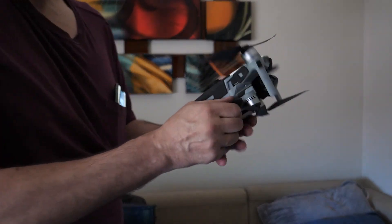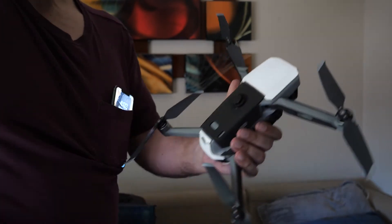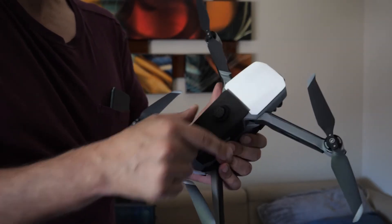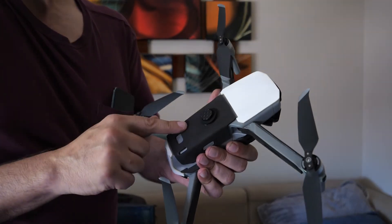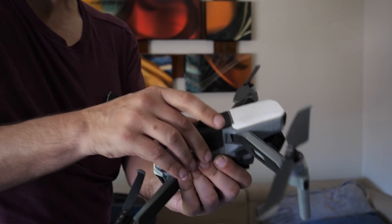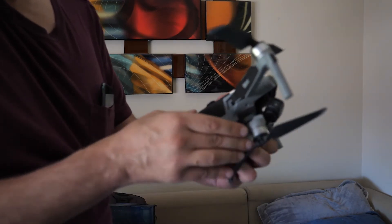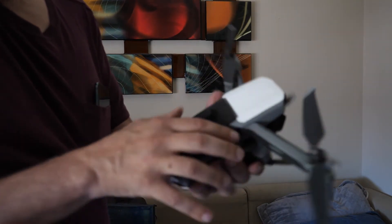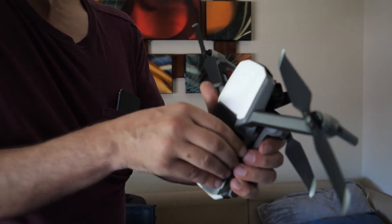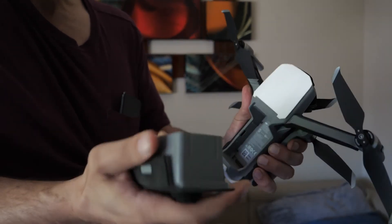The same exact thing applies to the Mavic Air, except it's a little smaller, but the principles are the same. You're creating an airtight seal all the way around the battery, you create the vacuum, and if I try to pull straight up I'm not going to be able to do it — not with this grip and not with this angle. So I've got to put the legs in place, exact same thing. They protect the legs from any play, and now I've got a nice way of holding it. I can break that seal, and once I hear it broken, I'm good to go. The battery comes out and we're good.